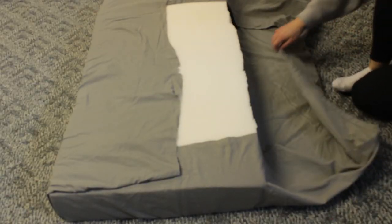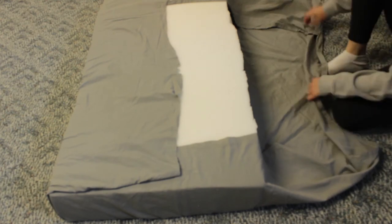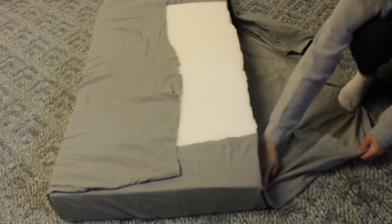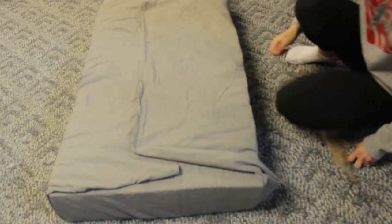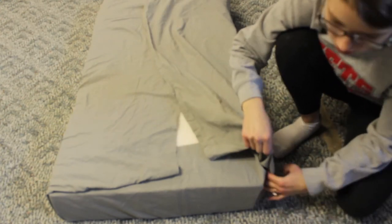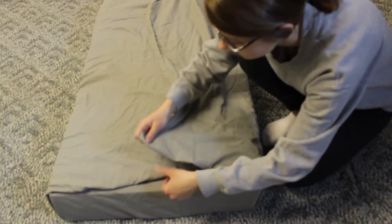As you can see we have that side done. I'm doing the bench seats right now. Basically you're just going to cut your piece of fabric and then you're going to tuck it in. There are many ways to do this but this is just what I found to be the easiest. It doesn't have to be perfect at first - pull it up and always make sure your finished edge is on top so it looks nice. These little corners you're just going to tuck in, and always make sure everything is flat and looks nice.